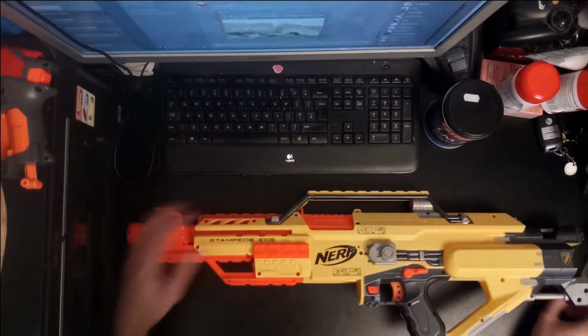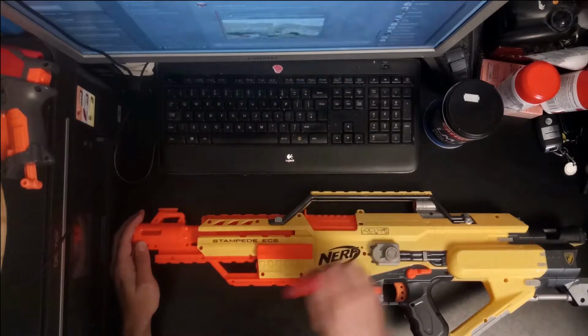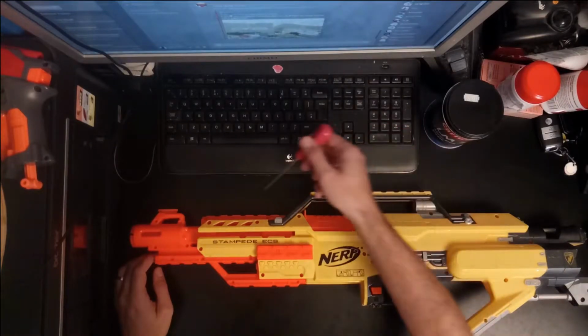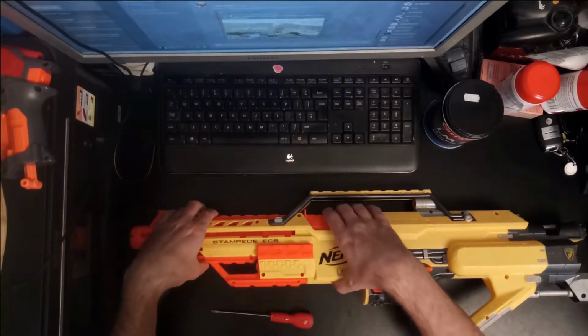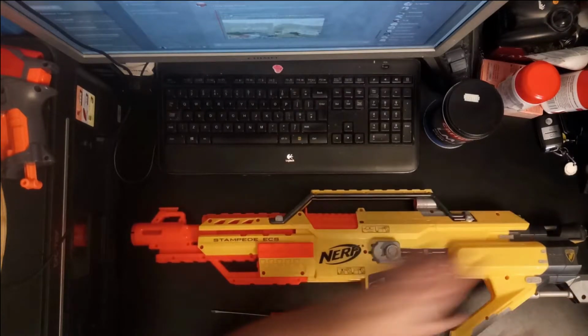So I should mention at this point, when you start, you can see the spring loaded attachment bits for the end strike attachment rails. There's 4 of these you need to watch out for. 1 up here, 1 there, 2 at the bottom here. It's the older style end strike ones, so they're all spring loaded. And you just need to watch them as you split the shell.